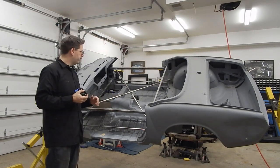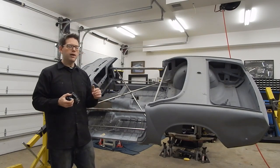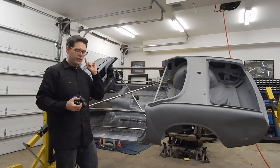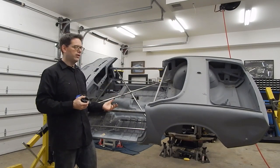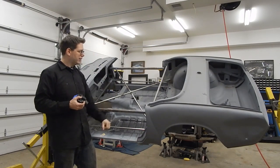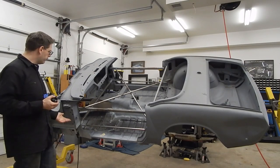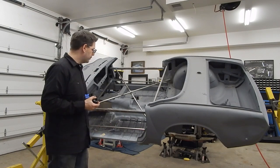I'm pretty confident that when I grind all the welds down and finish everything, it's going to look pretty much OEM in there. It's not going to be 100% perfect, and we could probably sit there and hammer and dolly it as much as we can, but there's a point where I'm going to say if it's OEM quality I think I'm pretty good because I'm going to put carpet in this. I want it to be strong - that's number one. It has to be structurally sound and done correctly so it won't rust in the future. I'd like it to have at least OEM quality in terms of its look, and I think we're pretty much there. I've got a lot more weld grinding to do and then some final dressing and cleanup, but that's pretty much in and done - our floor is essentially in.